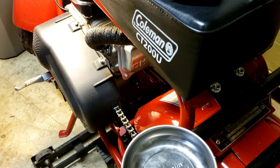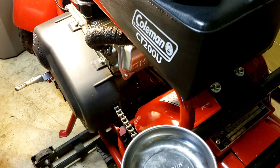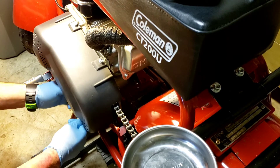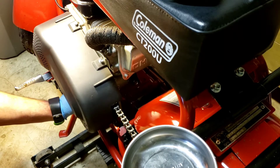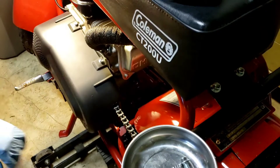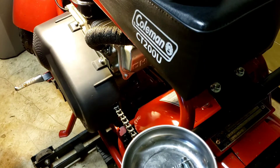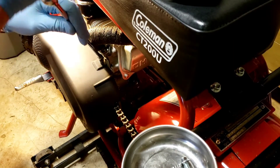Apologies for the heater in the background. This is not going to be a quick video because there's a lot of misunderstanding when putting these kits together. The random Chinese kits are pretty much all garbage, but any of the dual kits designed for a 420 or a 35 chain come with various spacers and the package doesn't tell you where they go, so people put them together all sorts of weird ways.